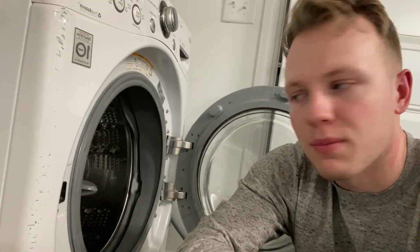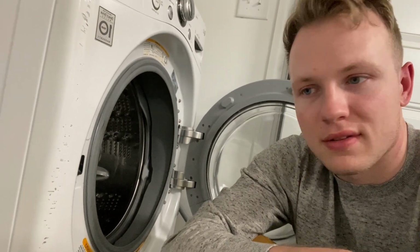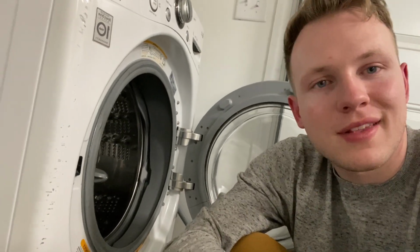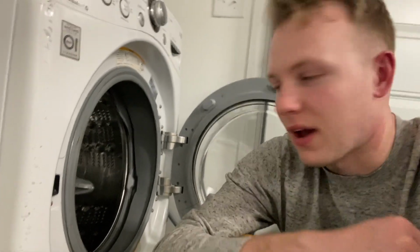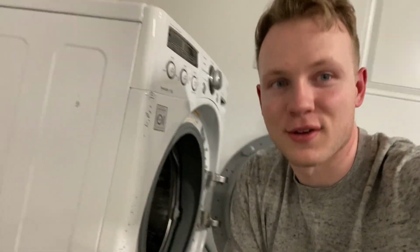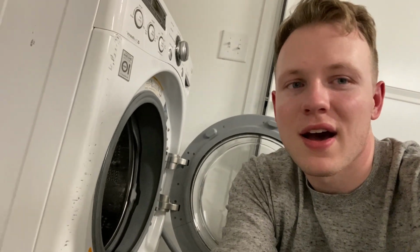Thanks for watching. The most important takeaway is don't let the buildup happen in the first place. If you're running your tub clean cycle, not using too much detergent or too much fabric softener, this won't ever happen, and keeping your door cracked. So that's the best advice, is don't let it happen in the first place, and you'll never have an issue.